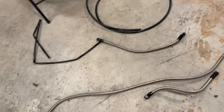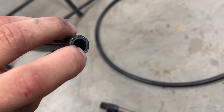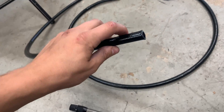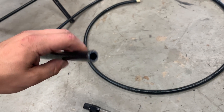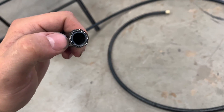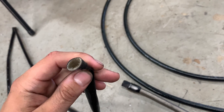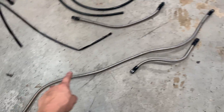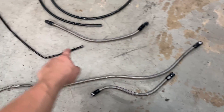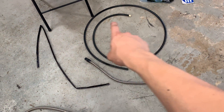Working on building my new fuel lines. I got some 8AN PTFE with a special conductive coating to stop the buildup of static electricity when fuel runs through it, so there's no spontaneous combustion. It has the PTFE itself, a metal sleeve, and an outer DuPont Hystrix sleeve. I also purchased an expandable silicone fiberglass sleeve from McMaster Carr — 10 feet of it — which should be plenty for the long return line, the secondary return line, and the feed line. I'll show a little bit about how these PTFE lines are going to go together.